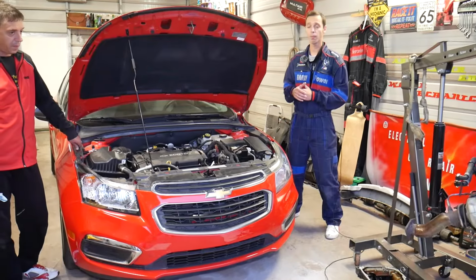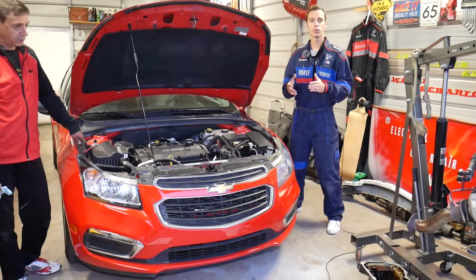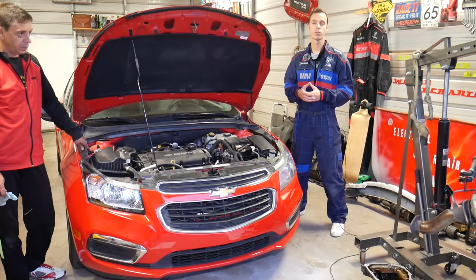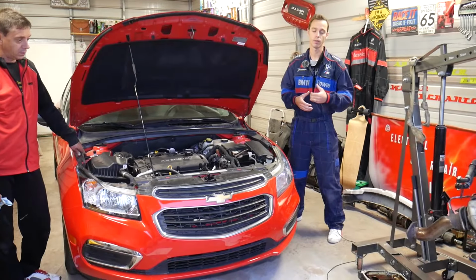Every time you remove and replace it, I recommend disconnecting your car battery. Why? Because first, it's electrical. Second, most newer vehicles have a knee airbag and you'll be close to it, so disconnect the car battery at least 1 hour before the repair, because you'll be very close to that airbag and you don't want something to go bad.